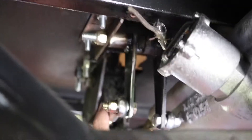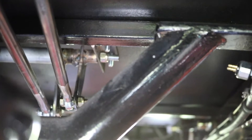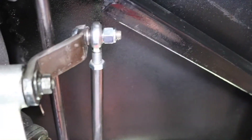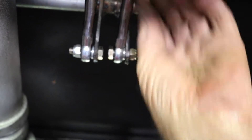When you shift gears here it moves this outside tube - watch this silver tube right here. You can see how it moves. With the shifter right there, that shifts the arms over here. What we've done is move the shifter over to that side, but for all practical purposes it's still on this side of the car. That is a feat - yes, some engineering went into it. I took 5/16ths rod ends, welded them into a piece of tubing, threaded the tubing, screwed them in and welded them in, and then the same thing down here.